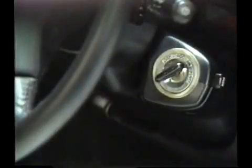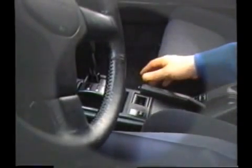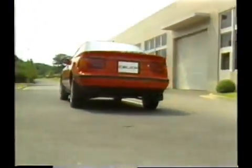Afterwards, if any of the following operations are performed, the speed sensor check mode will be cancelled. 1. The ignition switch is turned off. 2. The parking brake switch is turned from off back to on. 3. The brake light switch is allowed to come on 16 times or more. A road check is made without cancelling the speed sensor check mode.